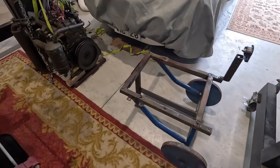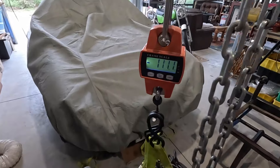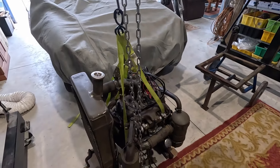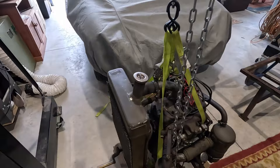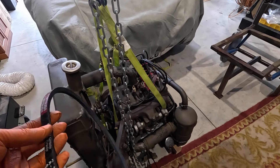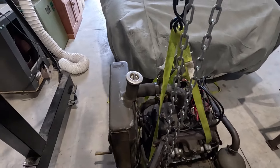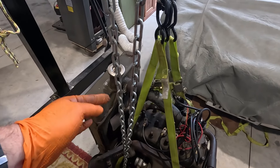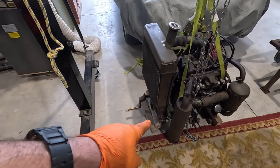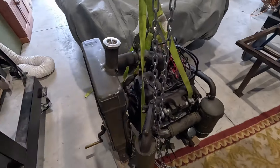With the stand out of the way and the engine back on the ground sitting up on blocks — I didn't want to rest it on the sump — you can see it weighs 111 kilograms. I need to take the radiator off. I did get a fan belt for it, an A28 — I measured it up and got what I thought was the closest. There's a little adjustment available but to get it on you have to get it over the fan, and there's not enough room between the radiator and the fan to squeeze it in, so it'll be easier to take the radiator off.